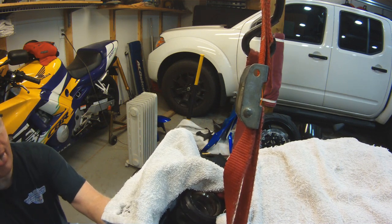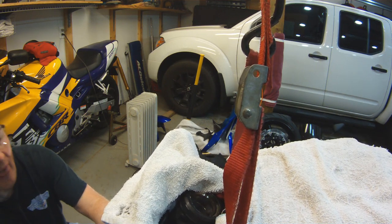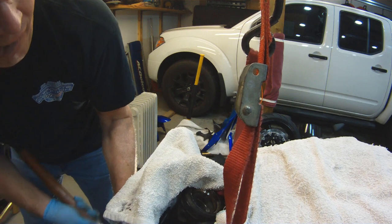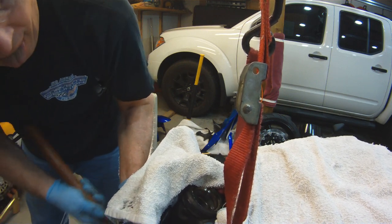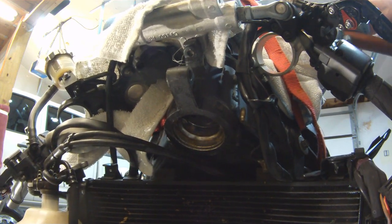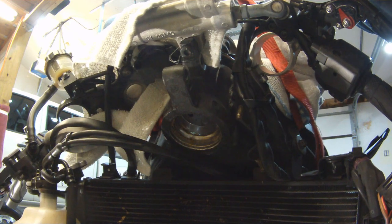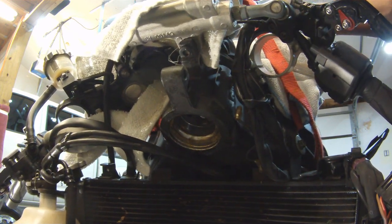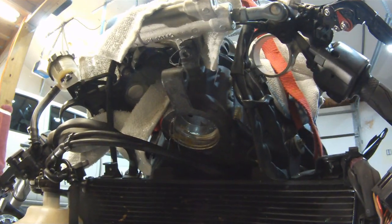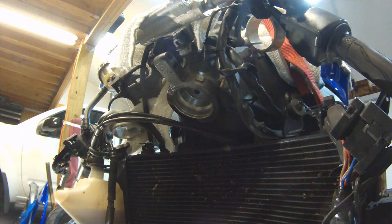we're just tapping on the bottom of the bearing race. There's two races, one at the top, one at the bottom. Both of them have to come out. So we're working on the one on the top right now. And if you just lightly tap, you need to do it at different angles, and then you see it pops out. And now we go from the top. And you'll do that a few times before it actually pops out. And there it goes. It's out. So our old races are out. Now we need to work on putting in our new races.